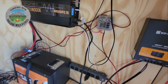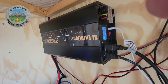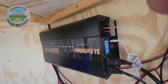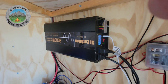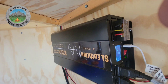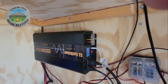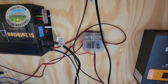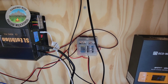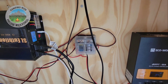Let me turn on my inverter. Once the inverter warms up, it will start drawing 11 watts on its own. So there we go — it went up to 11 watts. So if you leave your inverter on when you're not using it, you're draining 11 watts from your battery, just so you know. There is my 12 volt fuse block. I have three out of the six fused spaces in use: one going to my battery, one going to my lights, and one going to my overhead fan.